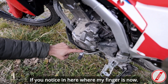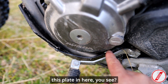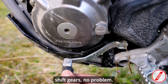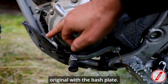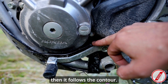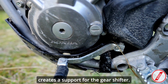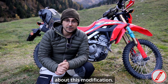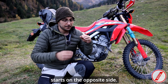If you notice where my finger is, there's a metal plate here that goes all the way to the back, and another plate coming from the bottom — they connect and allow me to shift gears with no problem even when the bike goes down. This is not original. I used the bash plate to give me support — it's welded to the bash plate here and here, and follows the contour. My idea is that if this area gets pushed, this plate creates a support for the gear shifter.